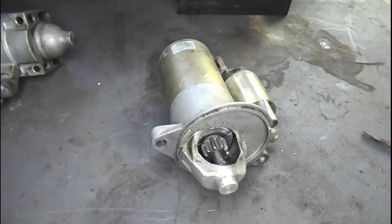As you can see, this starter does not work. If you have a good working starter and solenoid, this gear will come out and spin. If you do this test and the gear just spins in place but doesn't come out, that means the starter motor is doing its job but the solenoid is not working and not pushing the gear out. On the other hand, if the gear pops out but does not spin, that means the solenoid is working but the starter motor is more than likely shot. In this case, the starter motor is more than likely shot.